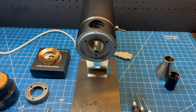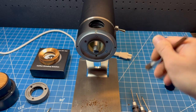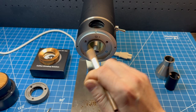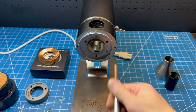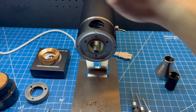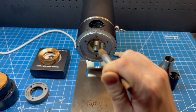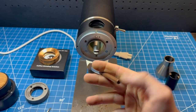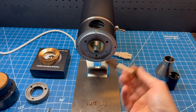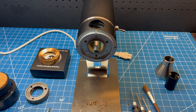Next we're going to give this part a good cleaning. It's important that the burr bed is clean when installing the new burrs, otherwise the new burrs may not sit very well. You can use the back of the brush to get any coffee out. The most important parts are this face right here and the aligning diameter — these two must be pretty clean.